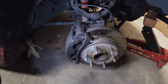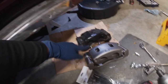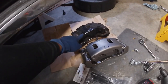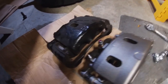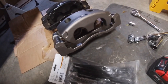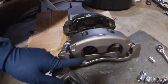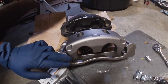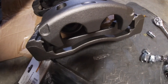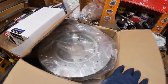After making a mess with brake fluid everywhere — this is my original caliper and this is the new 2007-and-newer model caliper, and that's my 2002 caliper. As you can see, they're virtually the same size and it looks like it will bolt on no problem. But from the side you can see it's a little bit deeper — the height is raised up higher here — and I believe that is to give that extra inch for the 13-inch rotor.